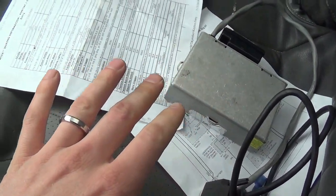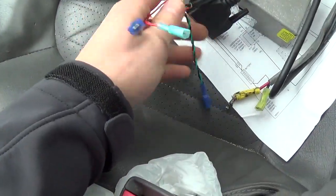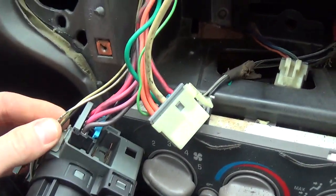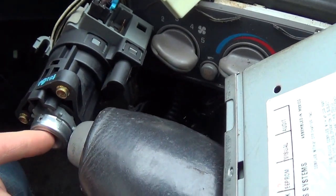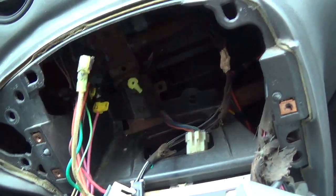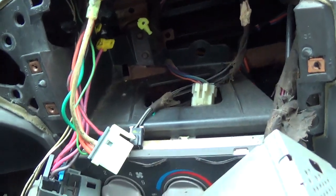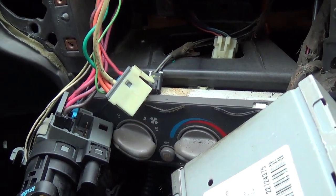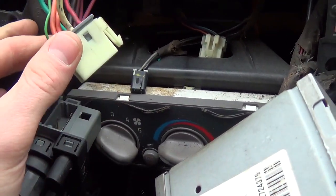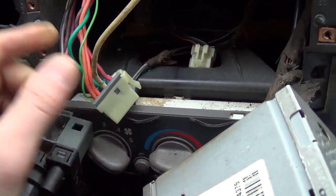The history is this car is from Florida — this was already installed — and I guess for Pennsylvania they need to rewire it somehow differently, put in a camera, who knows what. They re-initialized it, reprogrammed it, and that's when the problem started. Now the problem is they say when you turn the key to the accessory position, it'll blow a main fuse — a 40 amp. So somewhere in here there's a direct short to ground that's blowing this fuse, so you can't start the car. They've gone through like four fuses, and right now they have this plug disconnected, and they say with this plug disconnected it doesn't blow anything. That's good information.